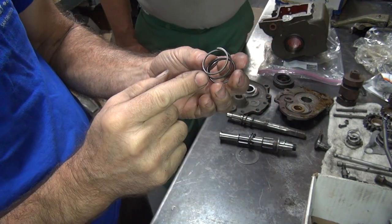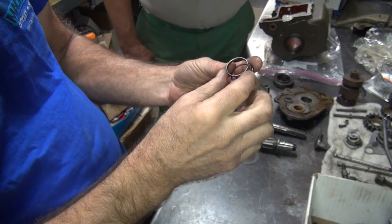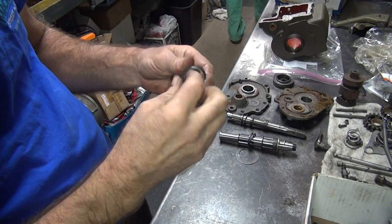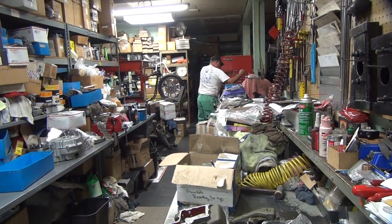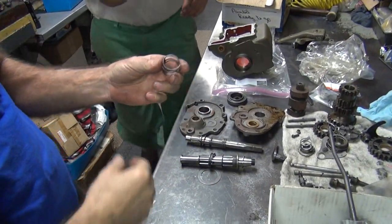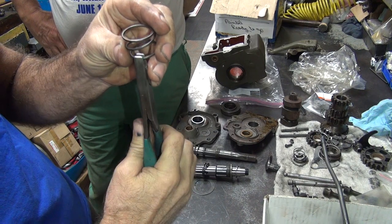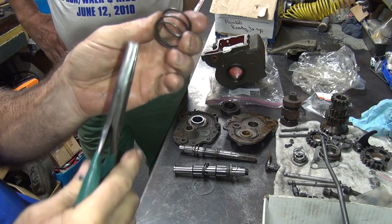That's the other one. Now this one's bent. See, this one's bent. So, need to take a hammer to it? I need a pair of duckbill pliers. Top long drawer of the toolbox, blue handle. Okay, this is bent right here. So when you take your duckbills and stick it right on the bend, like that, and you squeeze, it takes it out a little bit.